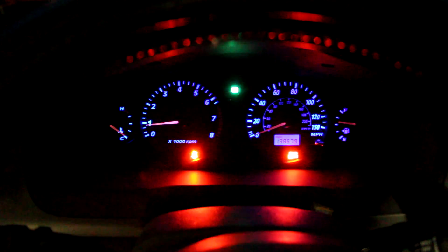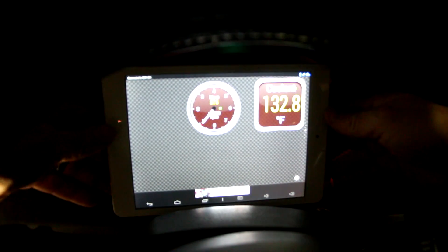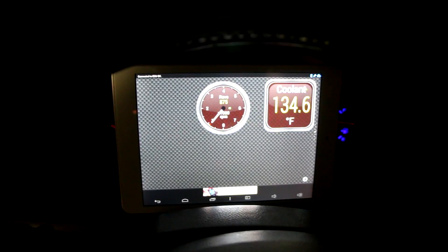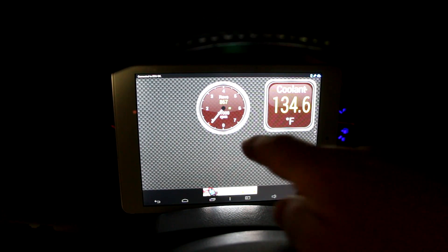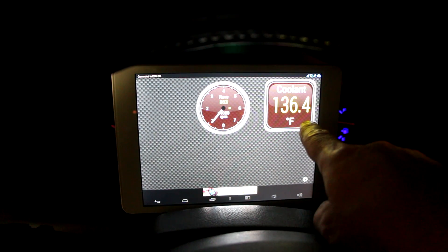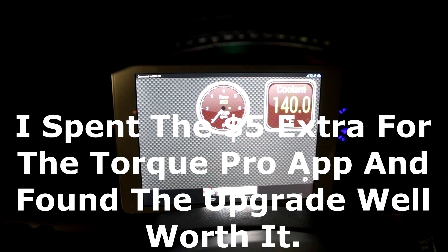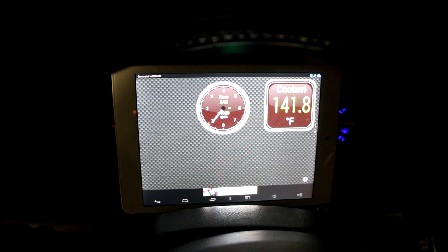One more thing — this is a beautiful little device that also does something else: it actually does telemetry from your engine. You can see right there my RPMs are 870, 863, and my coolant temperature is 136.4. So it's handy for a lot more things than just clearing your codes. You can actually make a display out of your tablet if you wish and it shows you all your engine telemetry. That's my video on how to clear a code using a cheap OBD2 connector, the ELM327 Mini.